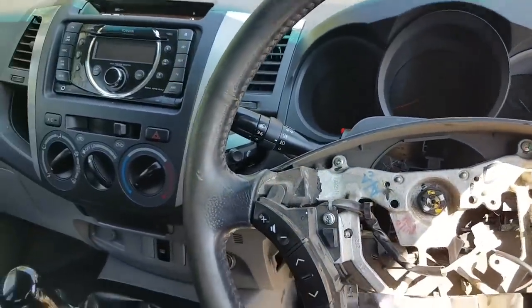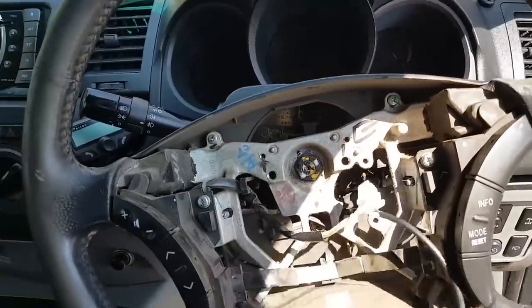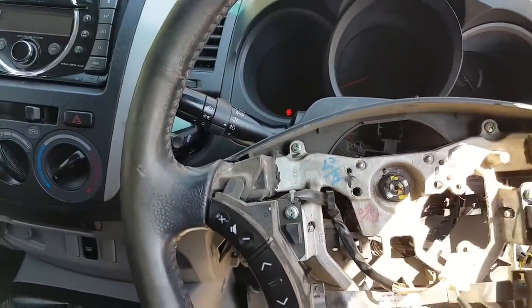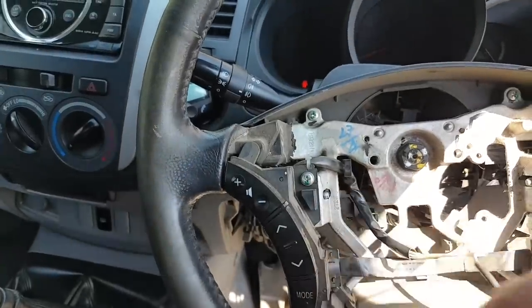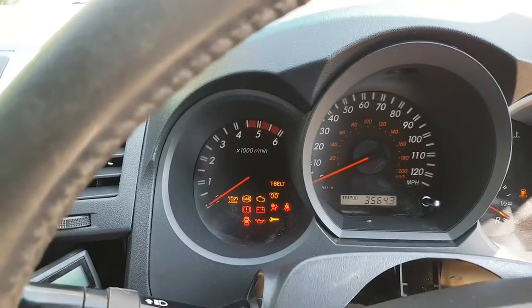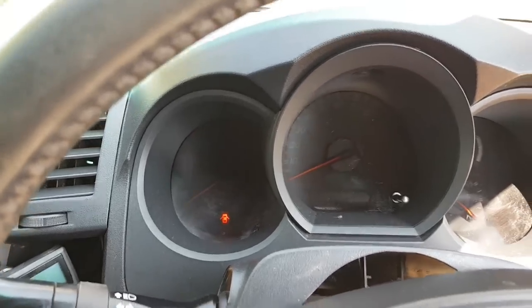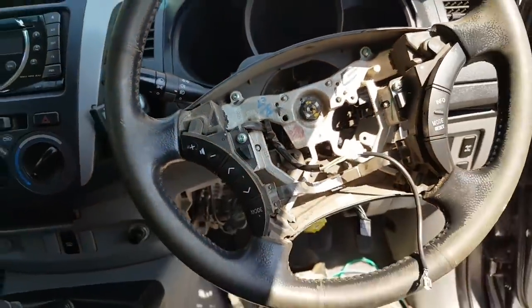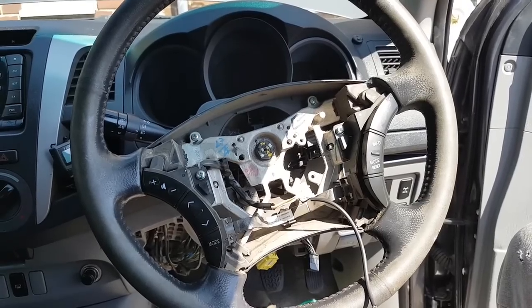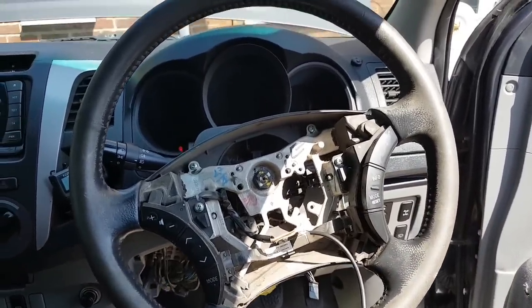Just one more thing before I leave this open to any questions. There's no airbag installed right now. Just in case you're wondering - the airbag light might have been related to the clock spring lanes. I tested all the lanes: the lanes for the buttons are fine and the airbag lanes are fine. But as you can see, when I turn the ignition on, the airbag light does not go off - because the lane that failed was specifically the horn lane. Everything else appears to be good. So really unlucky - only that one lane failed.